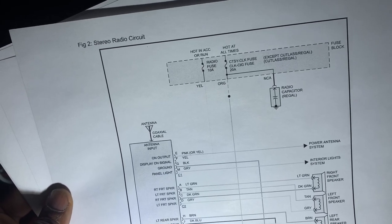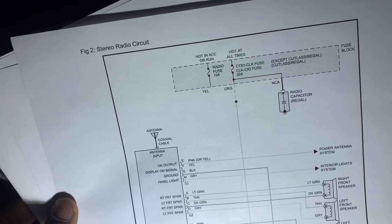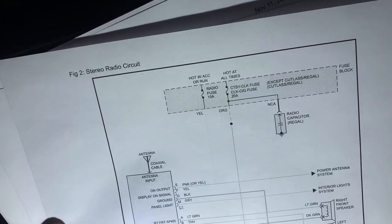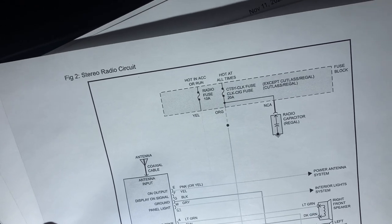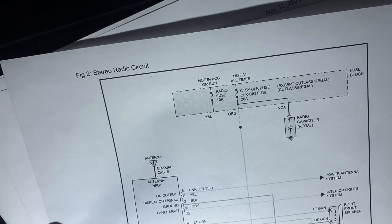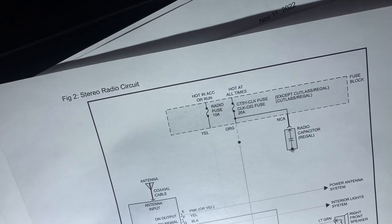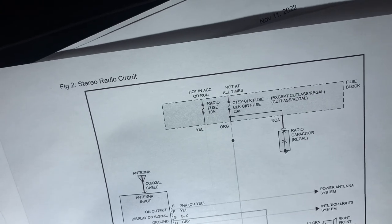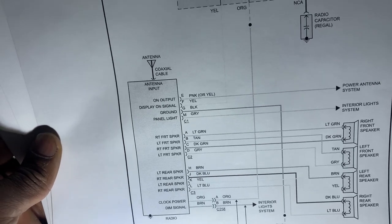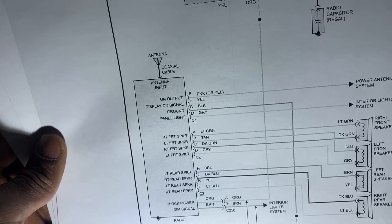What we need to find is our radio power wire. You don't want your radio powered up at all times, so the yellow wire is the one we're looking for. I'm going to run the display hot off of the cigarette lighter fuse because that one won't power the radio even though it's hot at all times — the display won't run without the main power. A lot of people run the display and power together, but I'm gonna separate them and see how it works. I'm not gonna solder and heat shrink everything today — just loosely getting it all together for y'all.